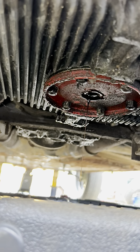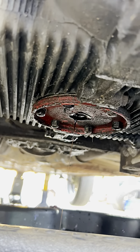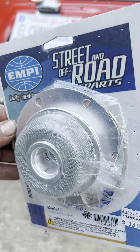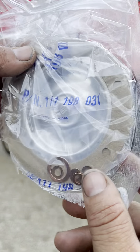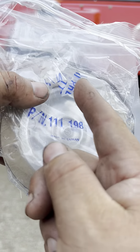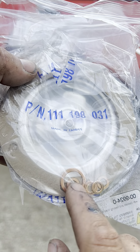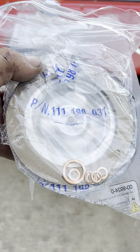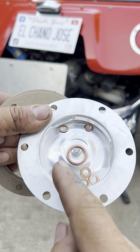The oil is still draining, so let it drain all the way out. Then we can start taking out those six 10-millimeter bolts and prep our new strainer. This filter or strainer is about $15 — not that expensive — and it comes with the gasket as well. We noticed this strainer also comes with copper washers for the six bolts on the bottom of the plate and for the drain plug, so be careful when opening the packaging so you don't lose them.